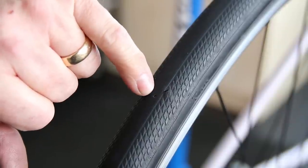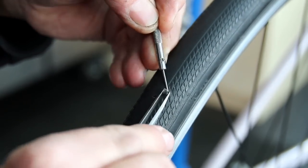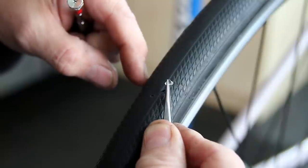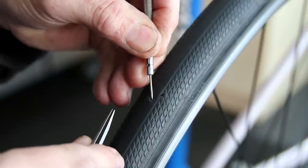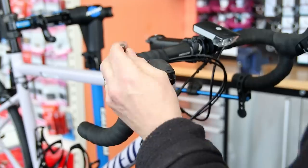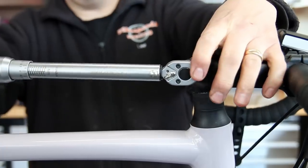One of the questions on our recent FAQ was about preventative maintenance, and I said to check your tyre for debris. Watch this - that right there is the next puncture on the next ride for this customer. A huge bit of glass inside the tyre; every time they went around a bend it would gradually work its way through the tyre and through the tube. Right next to it there was also a little flint. He might have had a puncture from the glass, replaced the tube, and then the flint would have pushed through for the next puncture. We saved this rider two punctures.